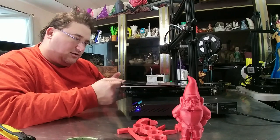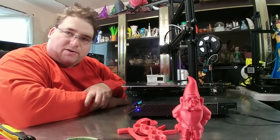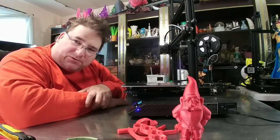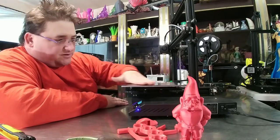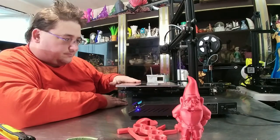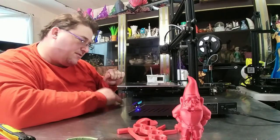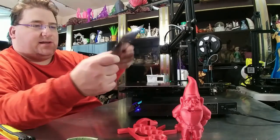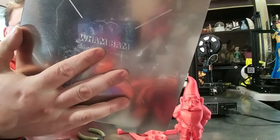I've run this thing for hours and hours at 125 degrees Celsius and it has not lost any of its magnetism. They claim it's safe to 130 degrees Celsius for its Curie temperature, which is really impressive. The print surface itself is kind of like PEI — they call it PEX, whatever that means — but it's a different surface than PEI. You can see it's transparent; you can see the Wham Bam logo they laser-etched into the spring steel.